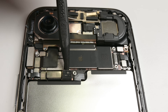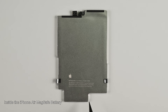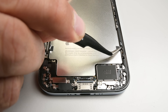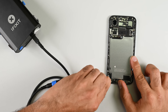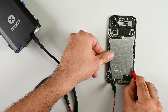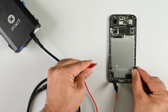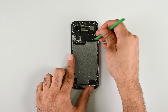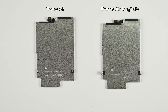With the battery disconnected, it's time to take a second look at the iPhone Air battery. We saw this same battery in the official Apple MagSafe battery pack just a couple of days ago. The electrically debonding adhesive returns for a third generation of iPhones, though there are now two adhesive strips that need to be addressed separately. Using my FixHub portable power station and vault clip, I connect the black lead to the grounding screw and the red lead to each tab in turn. After roughly 70 seconds per tab, the battery is fully released. From the model number to the regulatory markings to the 12.26 watt-hour capacity, this is the exact same battery from the MagSafe pack — and we confirmed you can swap it in and the Air will boot up just fine.